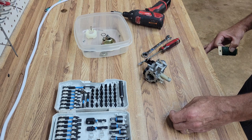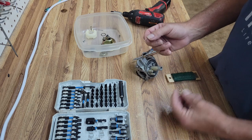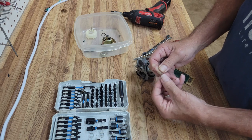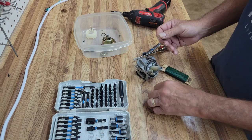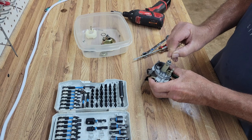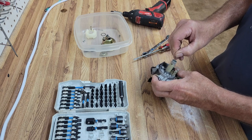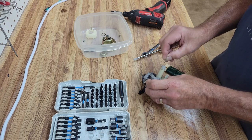Now everything's a little bit cleaned up. Instead of trusting just the ultrasonic, we're going to use what we call Christmas wire — the type of wire used to hang ornaments so you can't see it on a Christmas tree. It's a nice thin wire that fits inside all the little nooks and crannies well. We're just clearing any extra debris that might be in the jet, then we go down the center of the carburetor and do the same thing. There's a secondary orifice inside there. After we cleaned it, we blew the carburetor out really good, but that doesn't mean something big didn't get caught in there.